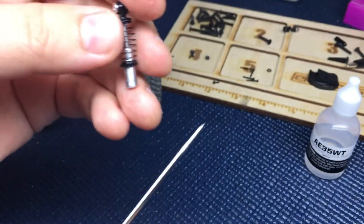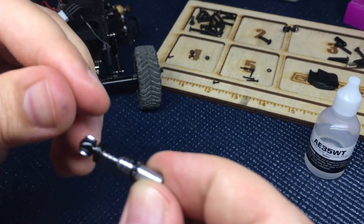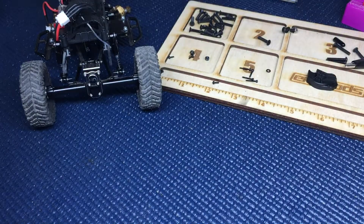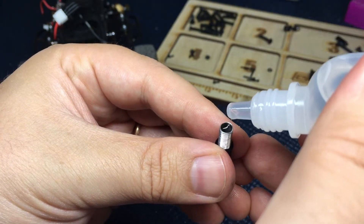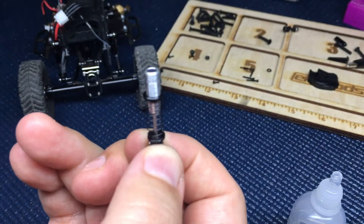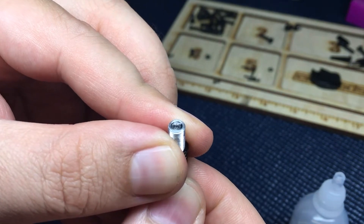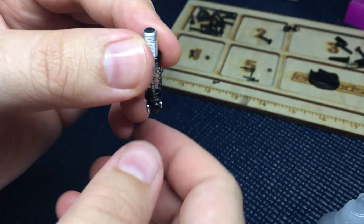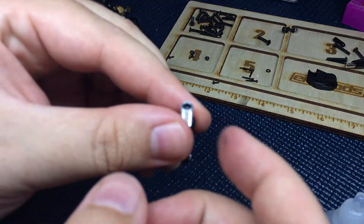You could unscrew this and wiggle through to open that up. Once you add the oil it'll also have less friction. Just like any other shock build, when we start putting in the oil I'm gonna put in a drop or two, then slowly move the shaft up and down, letting all the oil down and all the bubbles out. Add a few more — averaged out maybe three or four drops. There are the bubbles coming out, so I'm just gonna set that aside and let the bubbles settle out.